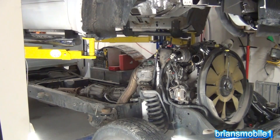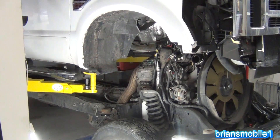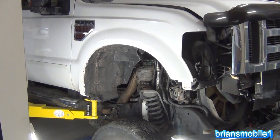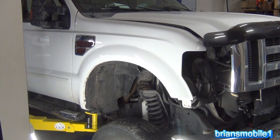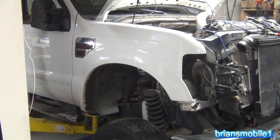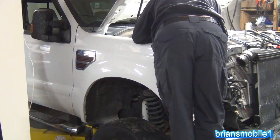I've got a great video for you today. If you're subscribed to my Facebook, Instagram, or Twitter accounts, you've seen footage or pictures of this job I've been working on — a 6.4 liter. Put new injectors, a new turbo, and a new rocker arm assembly in it. As a result of that, there's a bunch of air — all of those injectors don't have any fuel in them. In diesels, the ignition system is based on compression and high-pressure fuel. You can't have high-pressure fuel if there's a bunch of air trapped in the system. So what we have to do is get all the air out of the high-pressure side. You see this little valve here? That's what this video is about — how to make that so you can get the air out of the system. But at the same time, you've got to be really careful not to introduce any shavings or any debris into the system. Diesels are high-pressure and high-stakes — there's all these precision components made to a lot tighter tolerances than your gasoline counterparts. Stay tuned, come along, and I'll show you how I got this done.